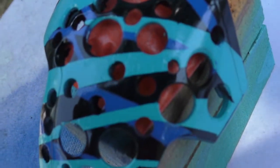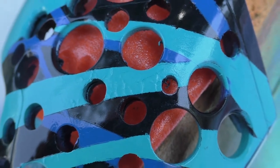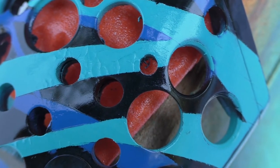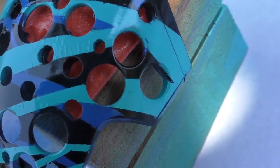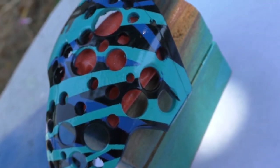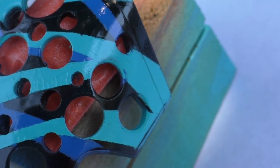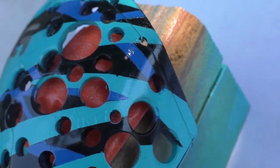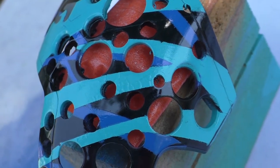On this one here, the light blue paint got these little cracks after I sprayed the clear coat. It probably has something to do with the paint not being totally compatible — maybe some grease under there — but it wasn't cracked like that before I sprayed the clear coat. What you can do is wait for the clear coat to fully dry — probably at least 24 to 48 hours — then take 1000-grit and sand it down until it's flat. I'll probably have to sand through the light blue so it's black again, then mask it off and spray a little bit of light blue, wait for that to dry, and then spray the clear coat. If you get a drip, sand it down with 1000-grit until it's flat, then you'll have to lightly sand all the clear coat again so the new coat will bond.